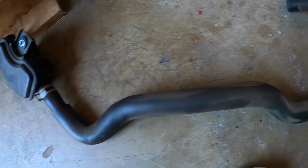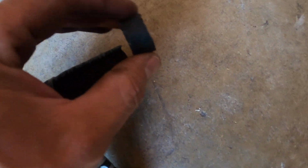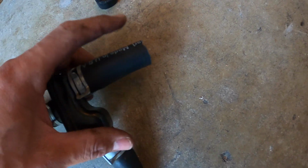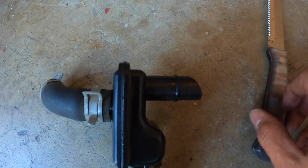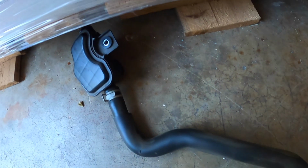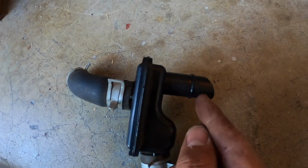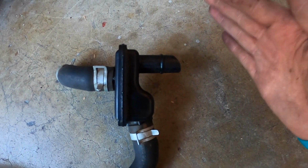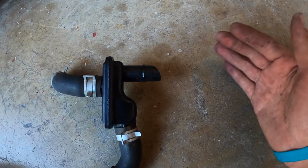So on this hose piece, you're going to cut the rubber about 1 inch off so it fits perfectly snug and doesn't push up against the brake lines or AC compressor stuff in the corner. Now before we cut the hose, you're going to want to trim this plastic piece on this intake tube here. I'm going to trim it as close as I can to this line because we need a little bit of a gap, that way the intake isn't knocking up against the corner over here.